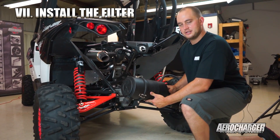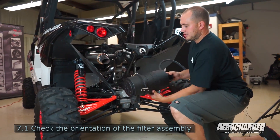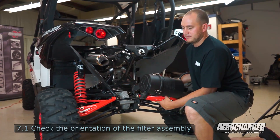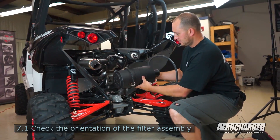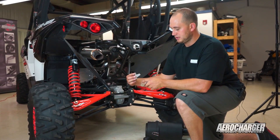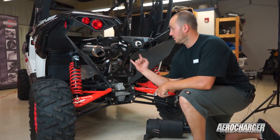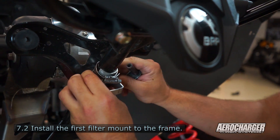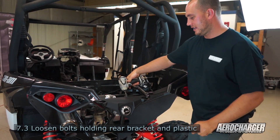We use a Donaldson-style air filter — works great for this kind of application, great in dirt, oversized with plenty of airflow. Make sure it's orientated so that the charge tube is heading toward the front of the vehicle with the drain facing down. It should come that way in the kit; if not, it's easy to pop apart and rotate. It's going to sit in here using these two aluminum brackets. This one has an angle to it — you want that angled up because the Donaldson will rest against it. There are two 13mm bolts; it'll mount up here and is held on by two hose clamps.